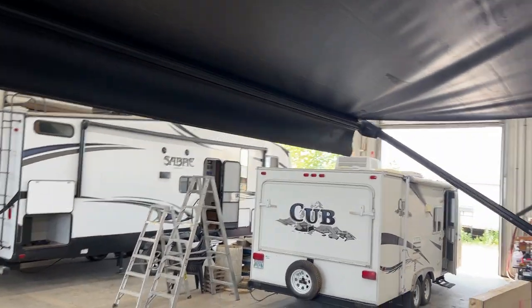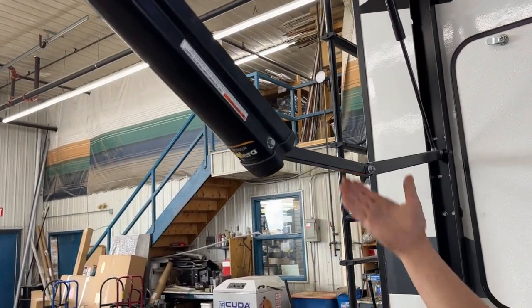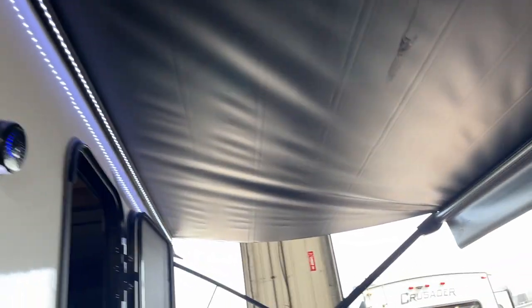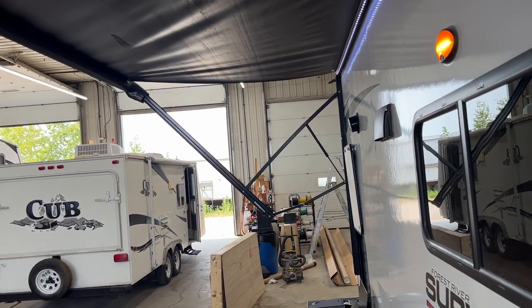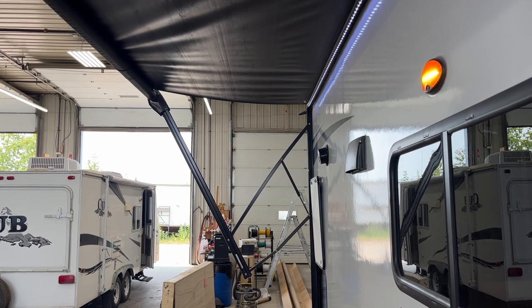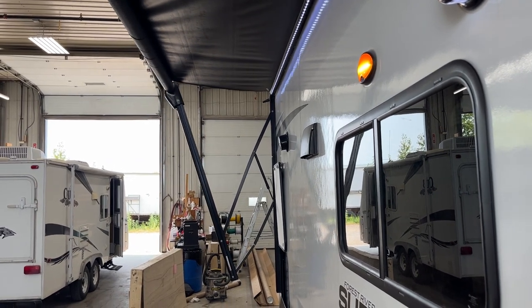There's the flap and the tube, so we'll stop right there. If it starts raining, the awning will hold some water — what you can do is grab either arm, front or rear, and pull straight down. That changes the pitch of the awning at the head, allowing water to run off. You can do the same with the arm up front for more shade. Before bringing it back in, make sure the arms are back out straight and fully extended so you're not risking bending them. Press and hold the retract button and the awning makes its way back in — just watch to make sure your fabric is over top of the tube. Also keep in mind that at about 15-20 km/h wind, bring the awning back in so you're not risking bending the arms.